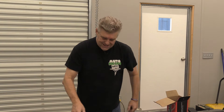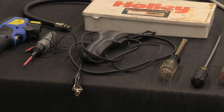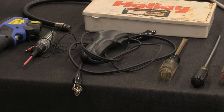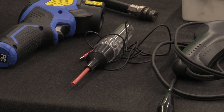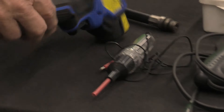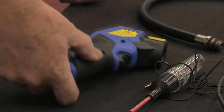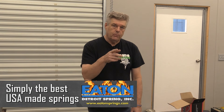If you don't have an ignition switch, a remote starter is something you're going to want in your toolkit. It'll let you do the things you need to do — turning the engine over for your compression test and things like that. I always have one of these in my kit. Little trouble lights with an incandescent bulb are always nice to check if you've got voltage to the areas you need. I've also got a Cobalt infrared thermal gauge so we can stick it right to where the exhaust manifold ports are when running the engine to see what our exhaust temperatures are at the ports and at the thermostat.